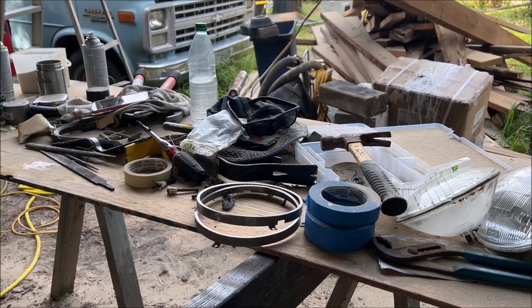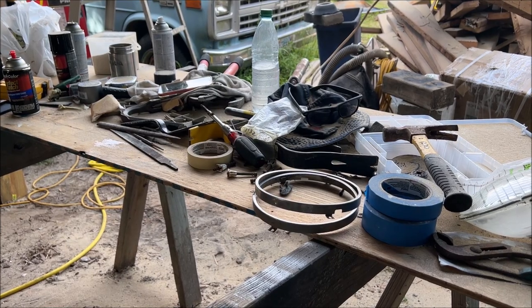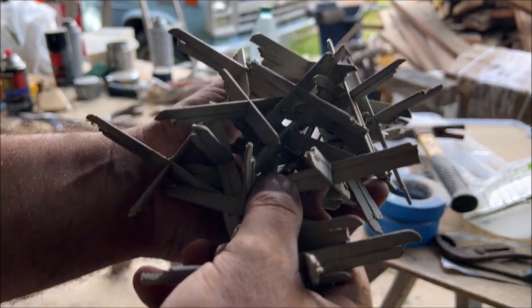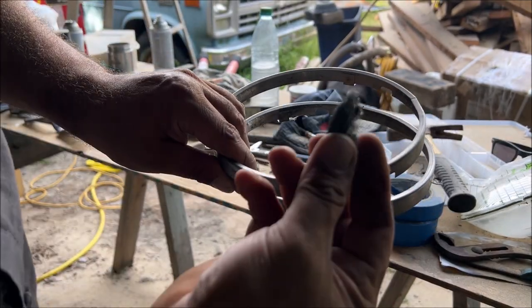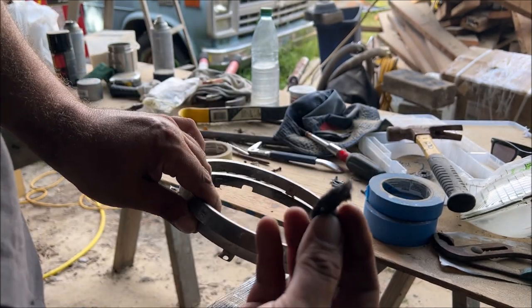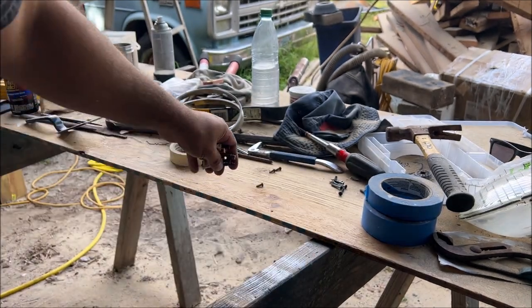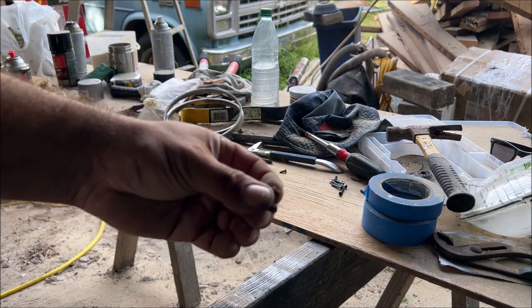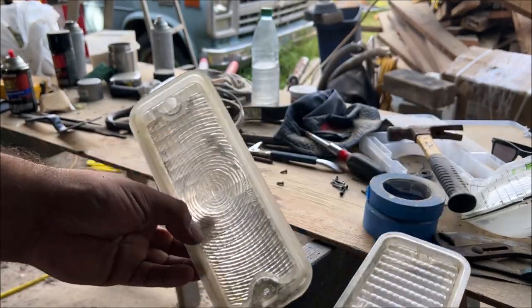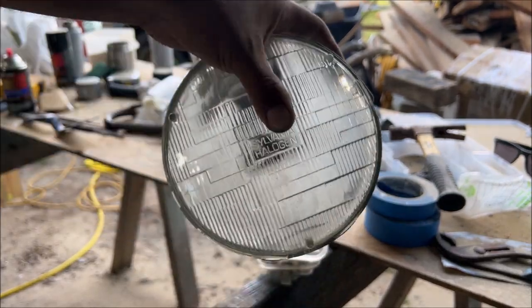That's why my videos are always messy — this table had nothing on it when I started. I want you to see every single little thing that has to come out when you actually do the work. We cut all these out of the donor grill — if you have a 1980 and some of these are busted, let me know and I'll put some on eBay. For the stainless headlight trim rings, use quadruple zero steel wool — do not use coarse stuff, you'll scratch the crap out of it. For headlight screws, we'll sandblast and clean them up. I found some replacement screws since the originals are messed up. For the lenses, I got new ones — if you have a clear lens you need an amber bulb. We're going to do an H4 halogen upgrade instead of regular seal beams.